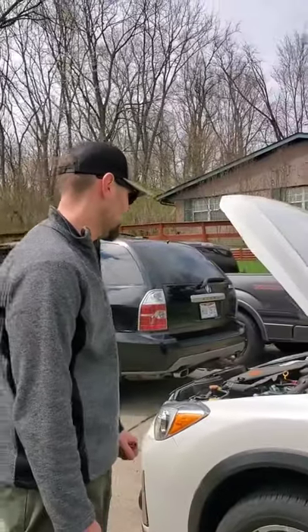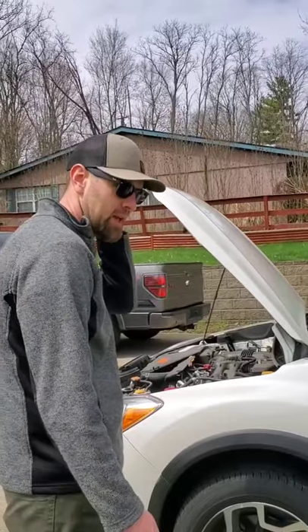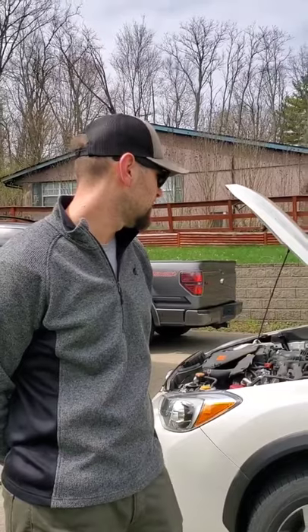What do we do in case of an emergency? If the check engine light comes on while driving, it depends on what you're experiencing. If you hear the car making noise, running rough, or you see the check engine light flashing, I would definitely get pulled over as soon as possible. If it just comes on and seems to be driving all right, it's probably not going to do any more damage — this could be a sensor going out. You'll likely be fine to continue driving, but at your next stop have somebody look at it, or pull into a shop and have them scan it to tell you if it's safe to continue.